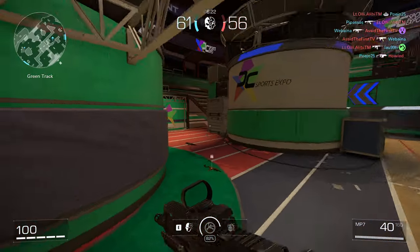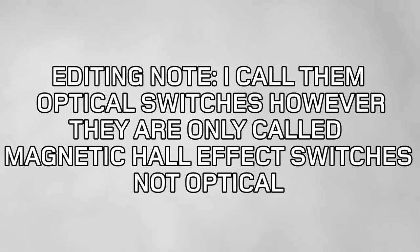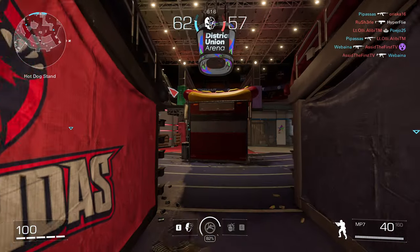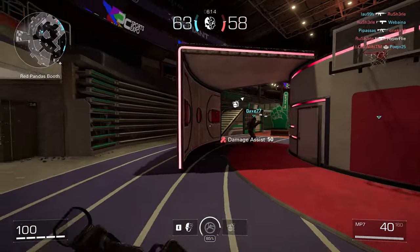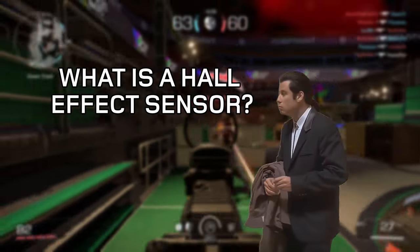Our Wooting fits in the linear switch segment. More specifically, it is an optical switch with a Hall effect sensor. Put simply, an optical switch does not have all the components that a common mechanical switch has, and will have a lower input latency. Now, you're probably asking yourself, what on earth is a Hall effect sensor?